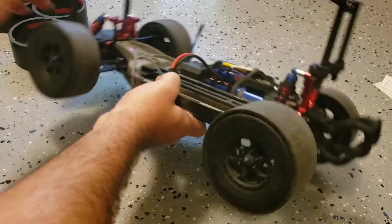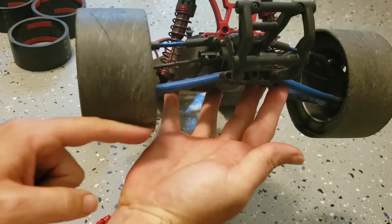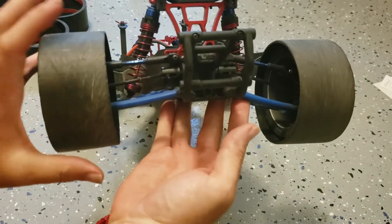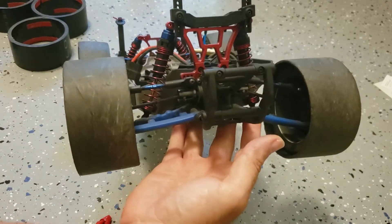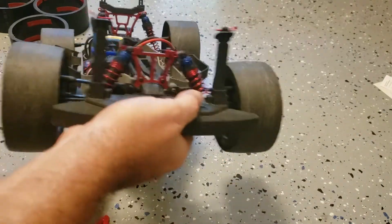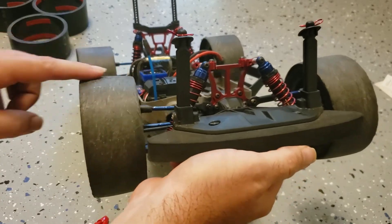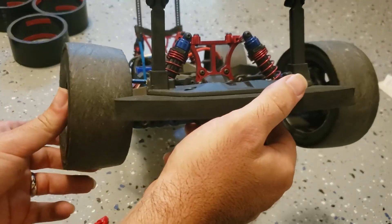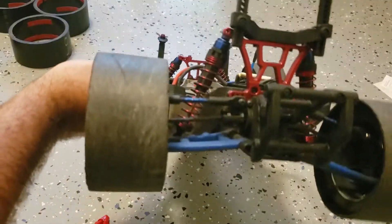In the rear, you're going to see that I don't have a whole lot of camber. You want to make your back tires flat — you don't want too much camber. They grip really well that way. On the fronts, just give a little bit; you don't even really have to mess with the front too much on the stock setting. As they start to wear, you'll see a bit of camber developing — if you get more than that, take a little camber out. In the rear, take it all the way out and try to get them to wear flat.